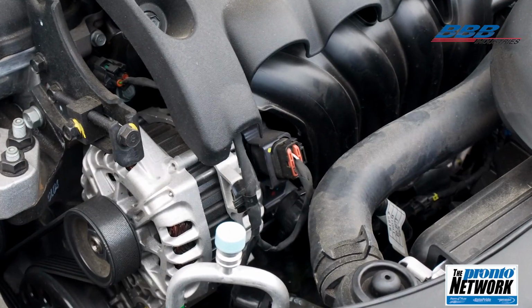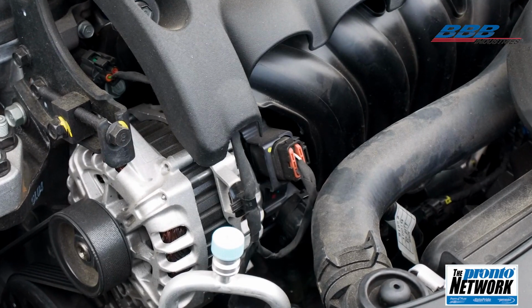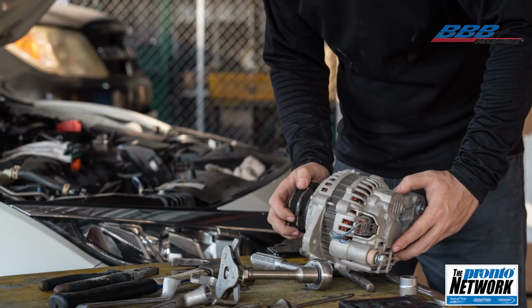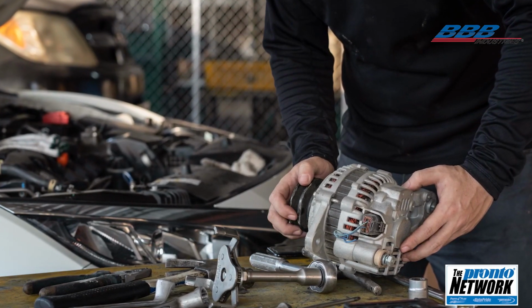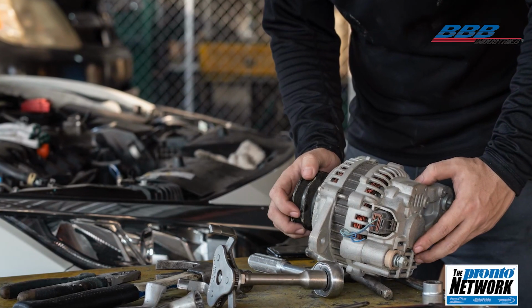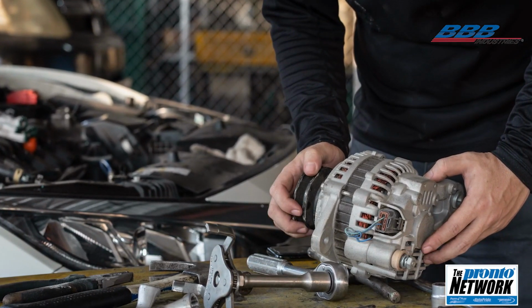Some manufacturers use underrated alternators that cannot produce adequate amperages at idle with high loads, though modern systems use load shedding to work around this. If the charging voltage is low, or the alternator isn't putting out enough current to keep up with the electrical loads that are placed upon it, don't automatically assume the alternator is bad and needs to be replaced, unless you're bench testing the unit out of the vehicle.